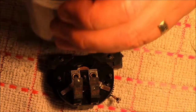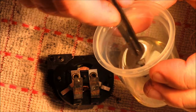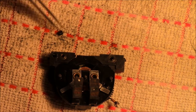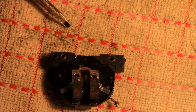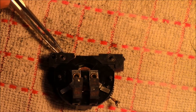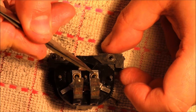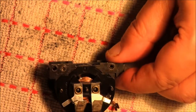Sometimes the easiest thing to do is take these wheels off — they do get in the way. Now we can do it properly. Put that back on, push it together; you'll feel and hear it click when you put it together. Just go around and work it with your fingers, ease it in, back on there — there we go. You heard that click — it's back on there nice and tight. That's what we want. So we'll put the brushes and springs back in. Just bend these arms up slightly, not too much, so you can get enough space to get in there with the brushes and springs.